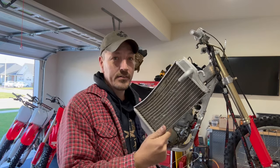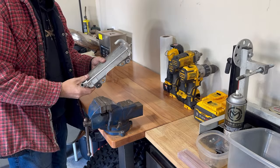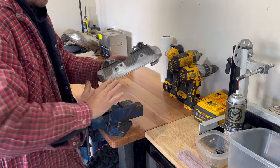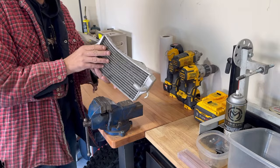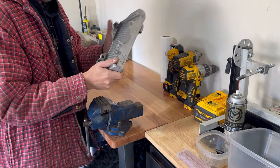In this video it's time to try and fix these rads — they're pretty bent. When dealing with radiators, the first thing to note is that bent inward is the easy fix. The harder fix is when you look down it and there's any twist. This one's not too bad.